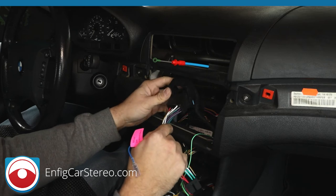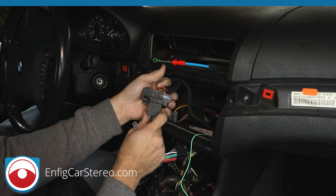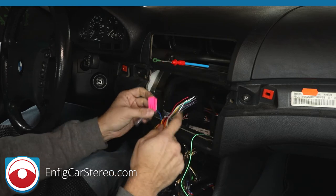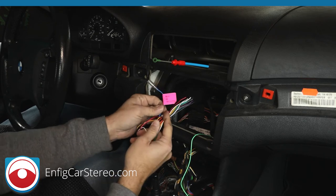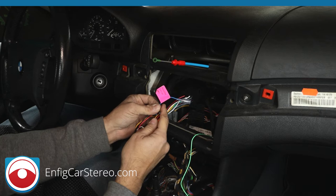this way. All right, so what you do is you put them in here on both sides, make sure they go in. And when you squeeze, see how it goes back? It makes a connection by itself. Okay. So this is very important. I still get a call about this. Must be connected. Wire turn on, amplifier turn on wire.